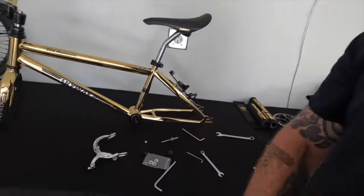So luckily I have parts piled up from builds over the years, but I'm gonna have to take apart this rear brake, pull that bolt all the way out, replace it with a front brake one. So maybe if you're gonna build one of these, make sure you get that hardware. I believe it comes with them anyway because the MX-1000s, correct me if I'm wrong, are pretty universal to where it comes with both that front brake kit or hardware along with the rear brake when you buy it anyway. Anyways, I'm gonna work on swapping that out and we're gonna show you the final result.